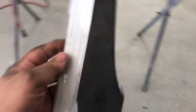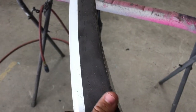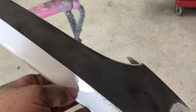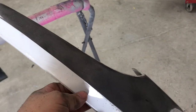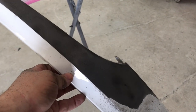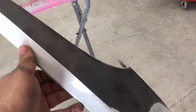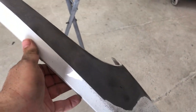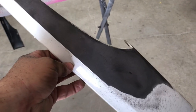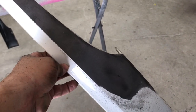The 80 grit made light work of the deep scratches. There are still a couple small ones, so I'm going to go over this now with 180 grit to address those little furry bits — little pieces of plastic sticking up like little hairs. I might have to go over with 320 and even 600 wet to smooth it up, because if you prime over that, you can prime it out, but it's abusing the primer. Too much film build on anything is never good. So we're going to sand through 180, 320, then 600 before we prime.